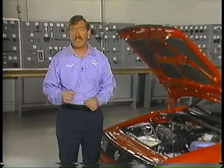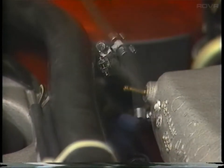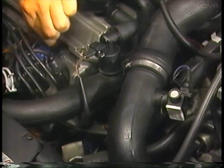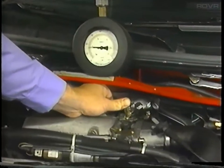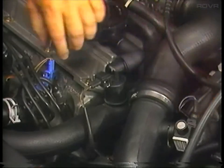Things to remember: when checking G-Charger output, make sure the engine is fully warmed before performing boost pressure testing. Make sure that the basic engine settings are correct and the knock sensor is functioning correctly. Always use hose clamps when connecting the boost pressure gauge VW-1397. Make sure the gauge is open. With the engine at idle, remove the harness connectors for the blue coolant temperature sensor plug and the CO potentiometer. Make sure the throttle is fully open, check the boost pressure reading, and when the test is complete, reconnect the harness connectors and remove the gauge.